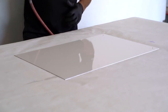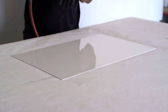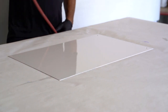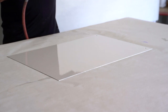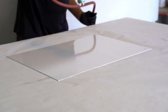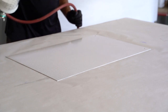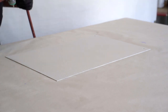So this is dry non-skid in a gun. I have a 2.1 tip — you could probably go all the way up to a 2.5. You don't really want to go anything smaller than a 1.8 or it might not come out. I've got the needle opened all the way up and I'm going to hold the gun up pretty high. You can cross coat it just to make sure you get it nice and even.